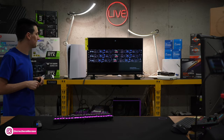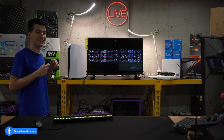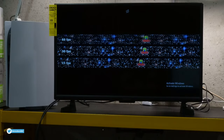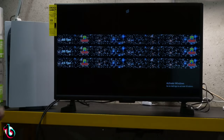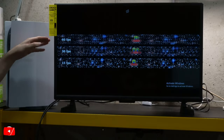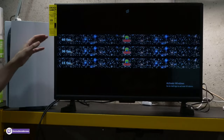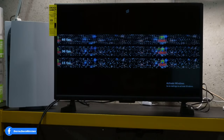Now you're looking at the UFO test on our Insignia 32-inch Fire TV. The resolution of this TV is 720p and it's 60Hz for the refresh rate. You can see what different FPS values look like at that 60Hz refresh rate. Obviously if we can match the refresh rate with our content we're going to get the smoothest playback experience. This really shows the importance of having a higher refresh rate TV — if we could have 120Hz or beyond, this would look really smooth and nice.